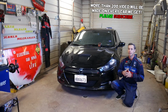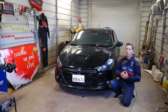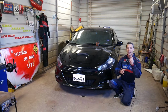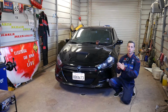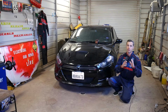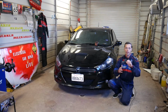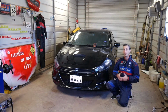Very important things that you need to follow, otherwise those airbags can kill you. First, you need to disconnect your car battery at least 1 hour before starting anything on airbag systems. Why? Because that way the system will discharge, and the possibility for something to blow up and kill you is less, but it's still there. So if you're not qualified and certified to work on airbags, don't do it, and consider this an entertaining video, not a how-to video.